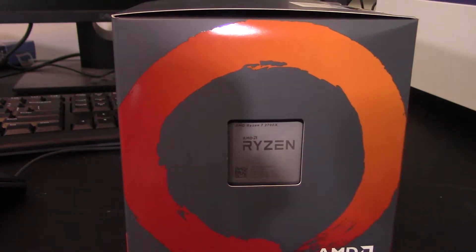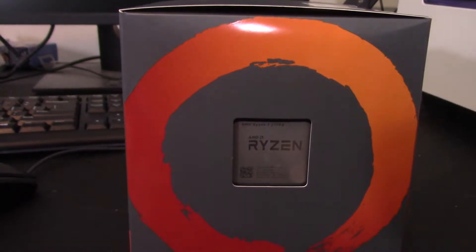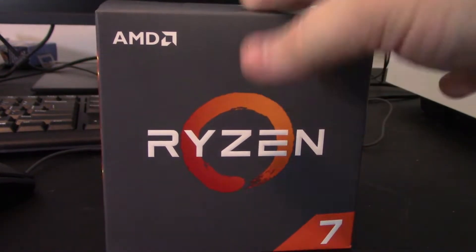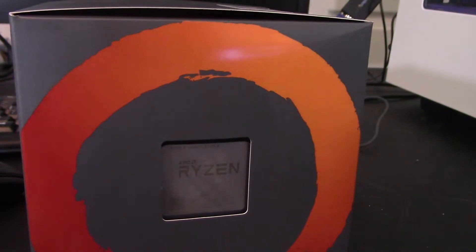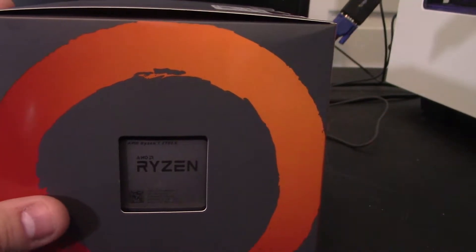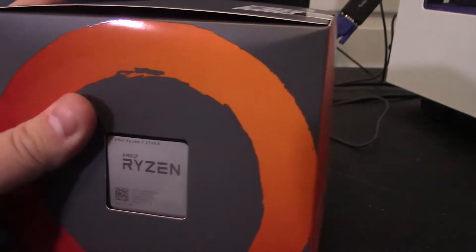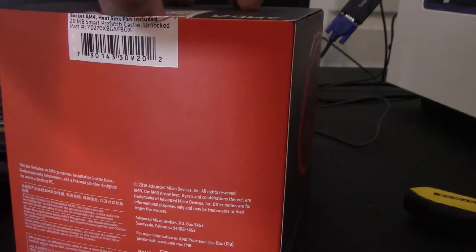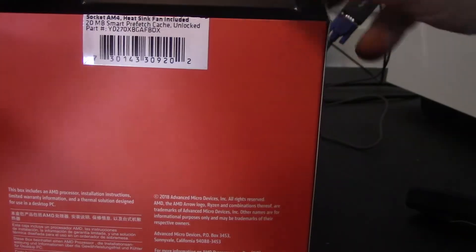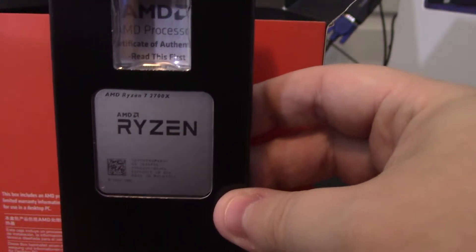It's not very common that I do this approach where I'm actually behind the camera working with everything, but I kinda want to do it this time. We've got the Ryzen 7, the SKU is the 2700X. I want the 2700X because I don't plan on doing any manual overclocking for a while. From what I've read, the single-core Precision Boost is great for single-threaded apps — it goes to 4.3GHz, which is about the cap of what you'll see. All-core speed can hit around 4GHz on a stock cooler.